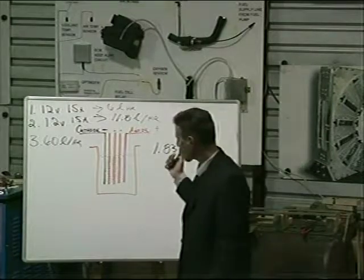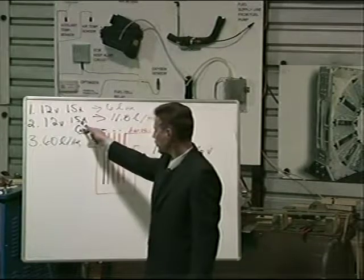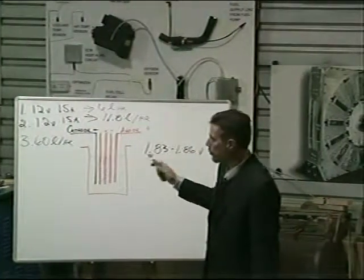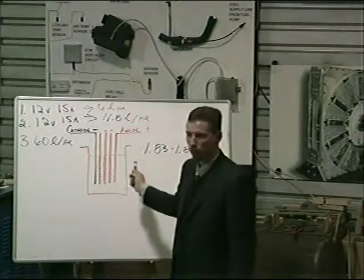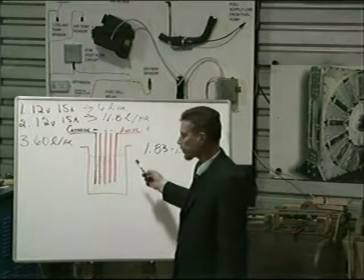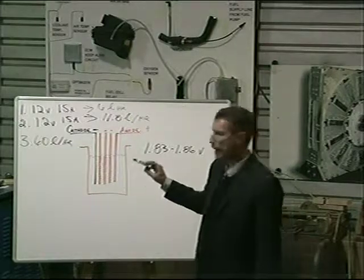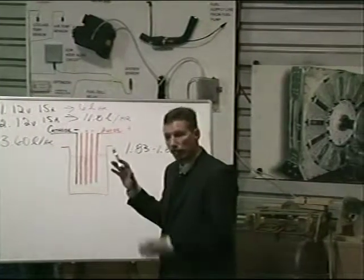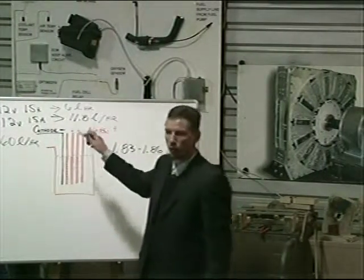So these fuel cells will have battery voltage, and we're going to tune them for 15 amps. The new revised version, which is underneath that blanket up there, is going to have actually 2 of these. Each will have its own feed, own relay, own fuse. So if you're doing a 4-cylinder engine, you only use one side of it. If you're doing a V8, you actually hook up both sides. But each side has a total of 5 plates, 4 cells.